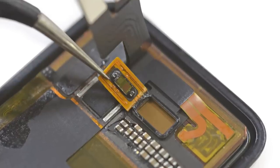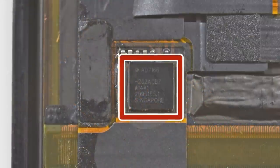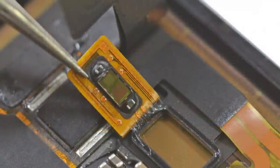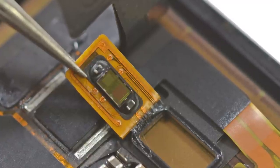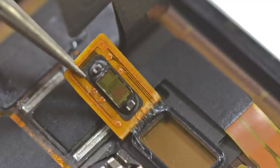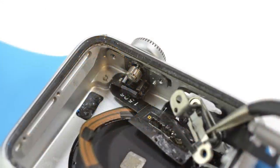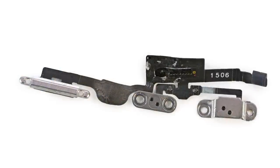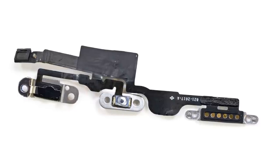After removing the S1, we check back with the display panel to find what might be an ambient light sensor and a lone chip — an ARM Cortex M3-based touchscreen controller. We're betting that oddly positioned light sensor is one of Apple's new solar cell ambient light sensors, which can be placed behind the display panel as opposed to the traditional surface-mounted design seen in most smartphones and tablets. The digital crown appears to have a nice encoder system, much like the Nest thermostat, branched off the same cable that connects to the single push button below the crown and the debug port contacts.